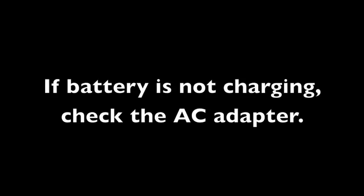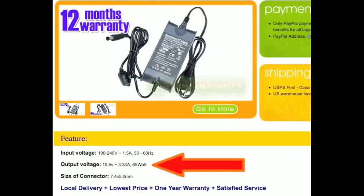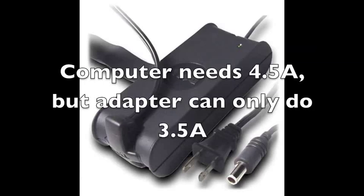If the battery is not charging, let's try to rule out some other things first. It could be a bad power adapter or bad AC adapter. If somebody's using an AC adapter that didn't come with that computer, it might not be putting out enough amps or enough wattage to actually charge the battery. I've seen Dells do this — power adapters that appear to be correct for Dell computers but they're a little small and don't put out the correct amperage. They put out too low a current and therefore, though the adapter powers on the Dell computer, it won't charge the battery.